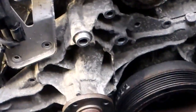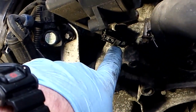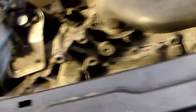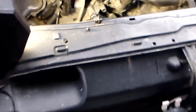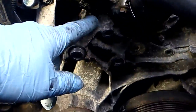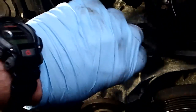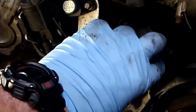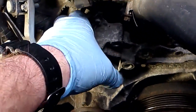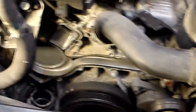I'm just starting to pull off the pump when I notice something. Let me get some light on that. Right there is the water temperature sensor, and there's a little curve on the top of the water pump that hooks around it. If you pull that water pump straight back, it's going to pull on that sensor and the plug will be in the way. So rotate the pump to the left and around the sensor while you're pulling it out. There we go — I should be able to wiggle it out of the hoses. There we go.